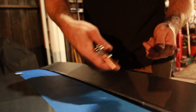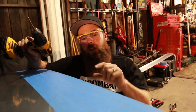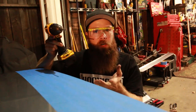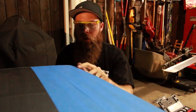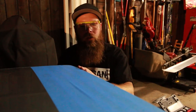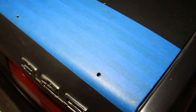I've upgraded to a quarter-inch bit, which is gonna fit my rivnut hole. I'm gonna bore these out. I recommend using a drill bit with a spade tip — don't use one with a pilot hole type tip because we already have our pilot holes and that'll screw you up. If you have a deburring bit, go ahead and deburr the hole. File it down if you have any obstructions or metal shavings. So far all the holes look really good — no walking.